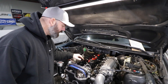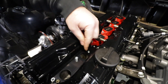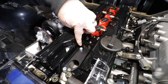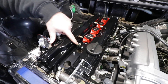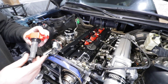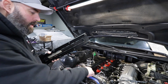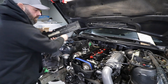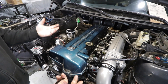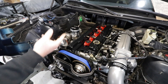We are bolting the Ignition Projects kit in place and I'm really impressed with the way they designed the mounting bracket that holds the coil plugs. There's a threaded pillar and on the underside of the metal mounting plate they use the same style to go into the cylinder head, then you hold it down with bolts on the top side. It's pretty obvious this will fit underneath the factory engine cover. If we pop the clear one off, we can drop the factory one in place to see how the engine bay would look with it on, though I like the access and serviceability of not having it on there.